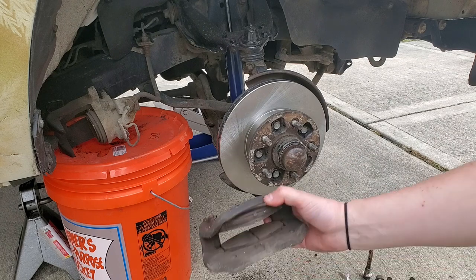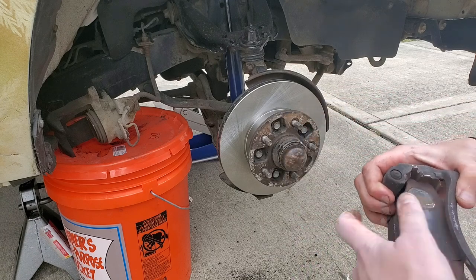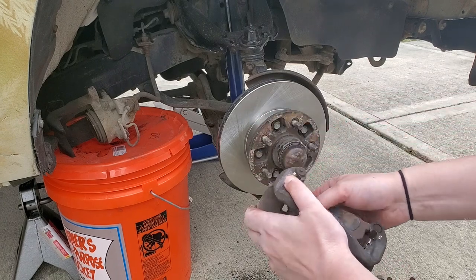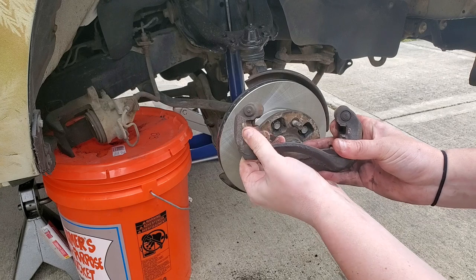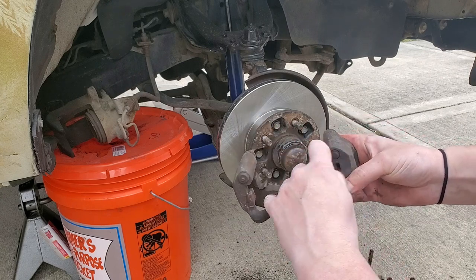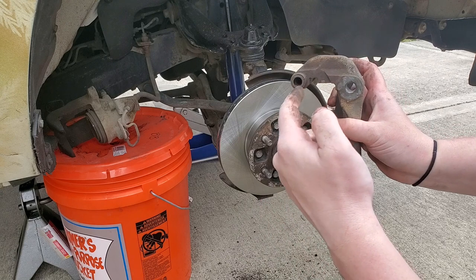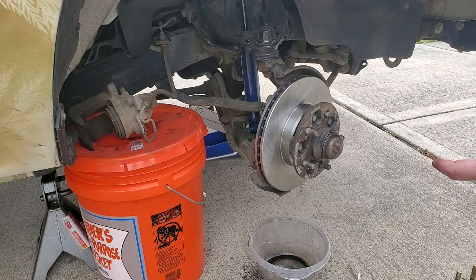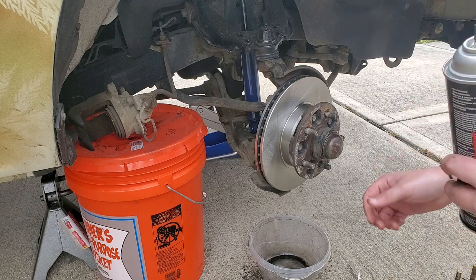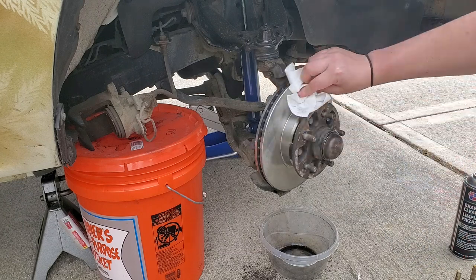Lastly I'm going to take care of the brake caliper. I'll start by taking it apart and wire brushing the bracket and caliper. The old brake pads just come out, along with the clips. You can buy new clips or reuse the old ones — I have new ones. I'll use a wire brush and some Q-tips to clean in there, clean the bolts, and re-grease those holes. I turned my wheel all the way to the left to give more access. Before putting the caliper back in, take the opportunity to clean off the rotors one more time with brake cleaner just in case you got any grease on them.